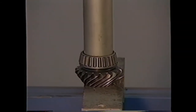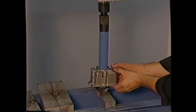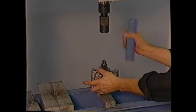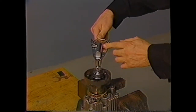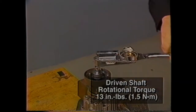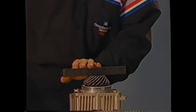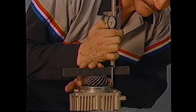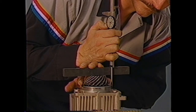Once you've installed the inner and outer bearing races to the extension housing, use a dial caliper to measure the distance between the flange on the driven shaft and the end of the pinion. Record the dimension — you can think of this value as the thickness of the pinion. Then use a hydraulic press to install the inner bearing onto the driven shaft and install it and related components into the extension housing as shown in the service information. Be sure to use a new crush sleeve spacer. With the extension housing fully assembled, measure the rotating torque of the driven shaft. A properly assembled shaft and bearings should have a rotational torque of 13 inch pounds or 1.5 newton meters.